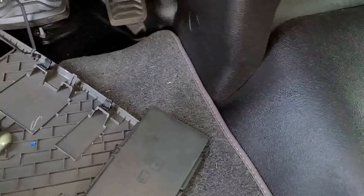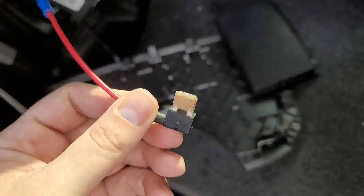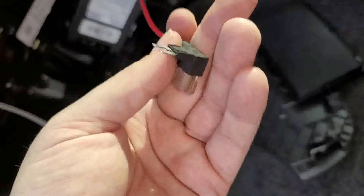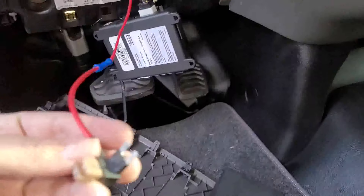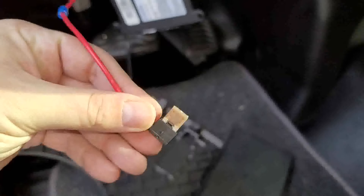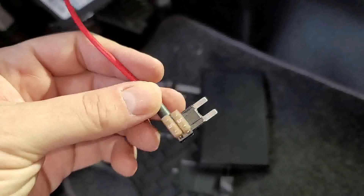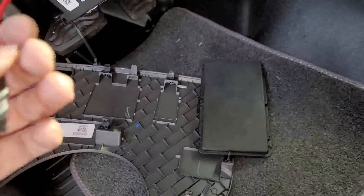So now we have to figure out why this fella isn't getting power. We think maybe one of the fuses is blown, but we're still looking into it. For the future person who doesn't have theirs working, this might be where you need to look — up under here in the dash. There seem to be two fuses on this end of the line. We haven't touched it or done anything, but we thought we hit debris today and maybe that did it. This is the line that's not getting 12 volts.